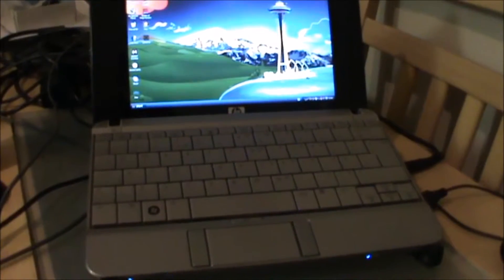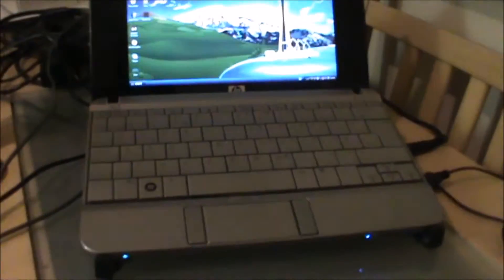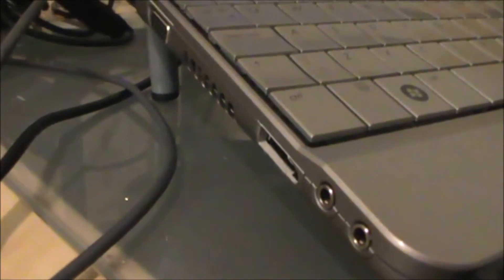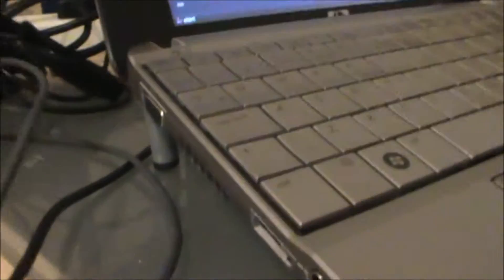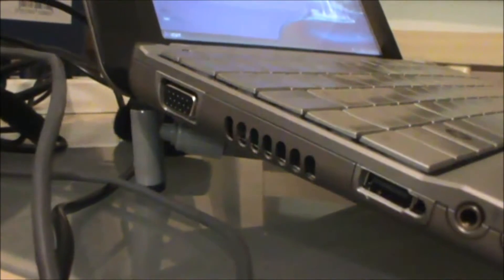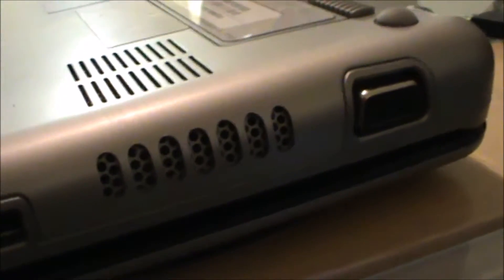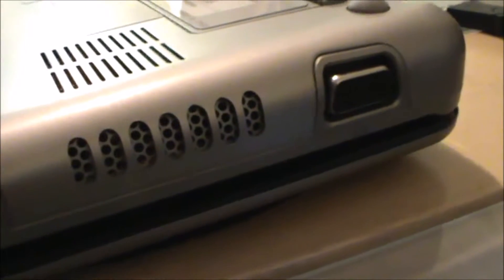I have rectified that on one machine — the one in front of us now — and I'm about to rectify it on my other one. At this precise moment, this machine is running pretty much silently and fairly cool as well. You may notice in the side vents there, it's completely exposed. Whereas on this machine, which is upside down, see that honeycomb meshing in there? That's what needs to be removed.